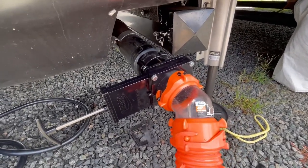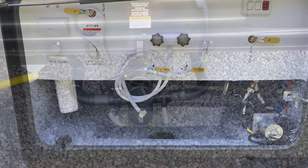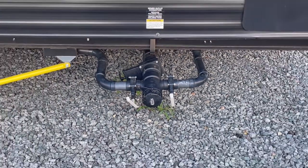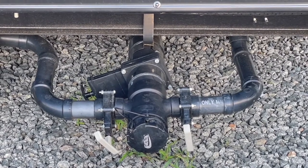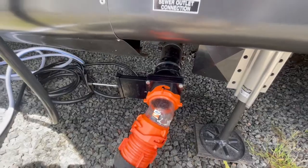That's a super easy and very needed upgrade, especially if you've got a wet bay. Most fifth wheels have the same cable system like I've got. Here's the motorhome that we had — you can see through that four-inch opening in the bottom, my sewer hose actually came up through there, and the cutoff valves — the gate valve for the black tank was on the right and the gray valve was on the left. So it was an easy cutoff. Here's the travel trailer, and that's why most travel trailers don't have to worry about all the drippings. Most travel trailers have got their main cap right there, with the gray tanks from the front and rear on each side, and the gate valve is right there at the opening. The big gate valve at the back is his black tank — so he's got three gate valves right there next to the opening. No surprises for him when he gets to the campground and pops his cap off.